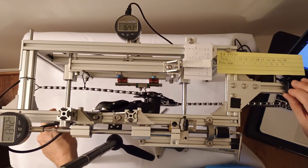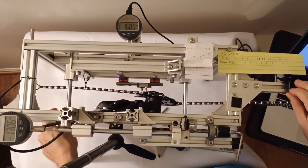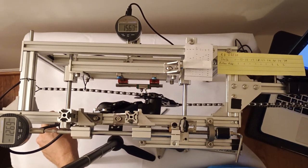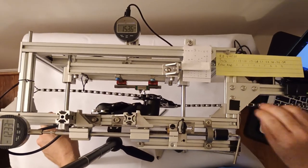When measuring the motion of the derailleur, I pull small amounts of cable and measure how far the jockey wheel moves as a result. I did three runs pulling cable and three runs relaxing cable by one-third of a millimeter at a time, taking 652 measurements in total.